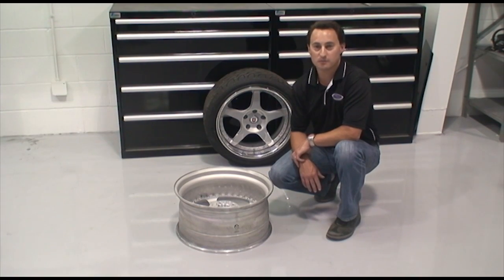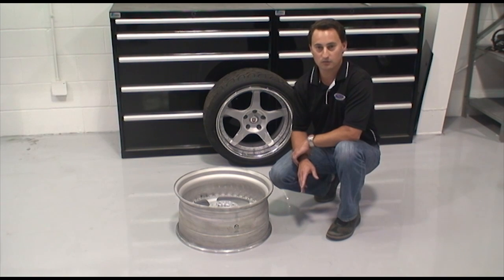When choosing a proper wheel size and backspace for your vehicle, it's important to decide whether you're going to leave your rear axle a stock length or if you plan on narrowing it. With a stock length axle, you'll have to run a much deeper backspace in order to fit the wheel correctly. At Detroit Speed, we recommend narrowing the rear end so that you can have a shallower backspace, which is much more pleasing to the look on the outside of the wheel for a muscle car.